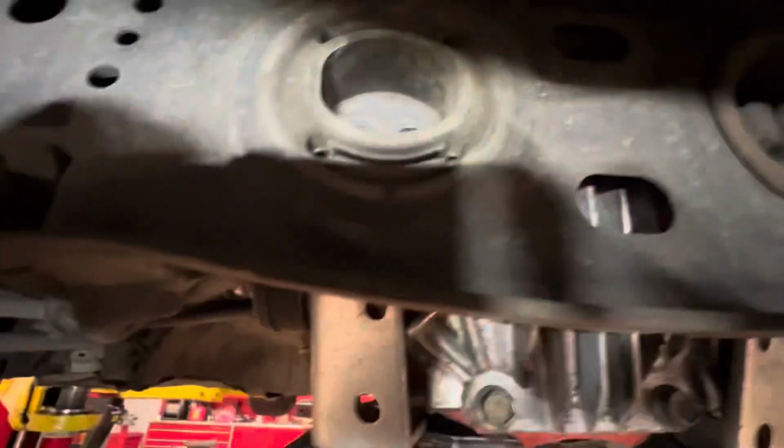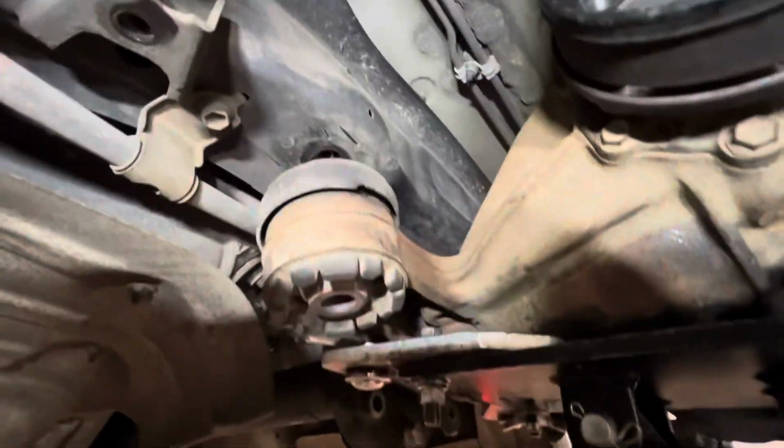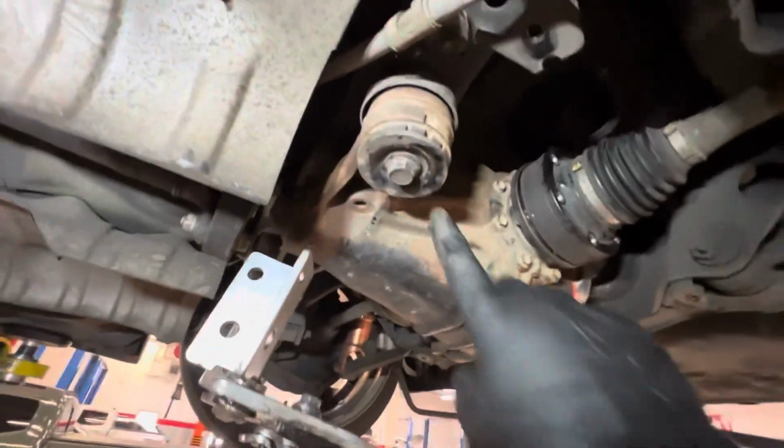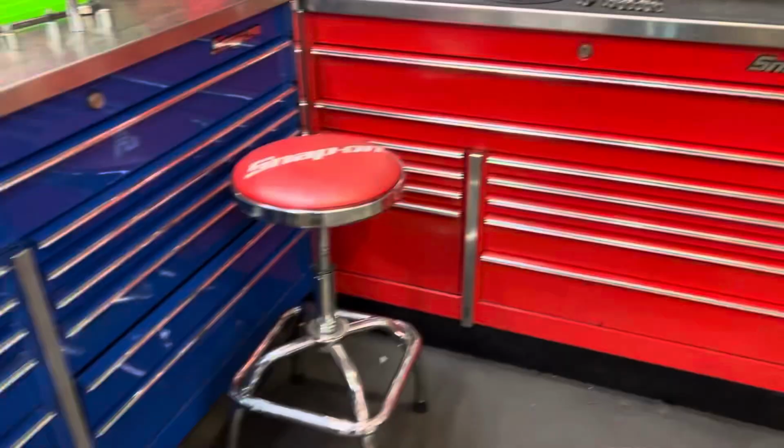And then everything's really close to lining up. There you go. So I'm gonna put these in right now, and then jack it up more, and then put the big ears in, and then go for drive shaft and axles. All right, it's in and it's being supported by itself. I got these 2 big ears to line up, while these 3 12mm Allens also lined up. So the big ears are tight, these are tight.